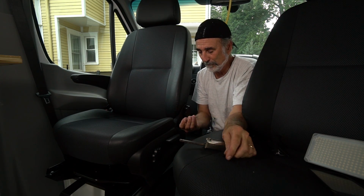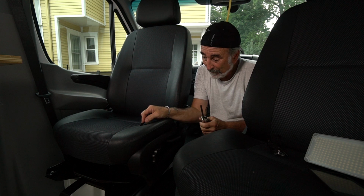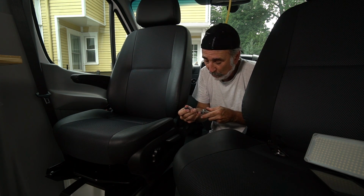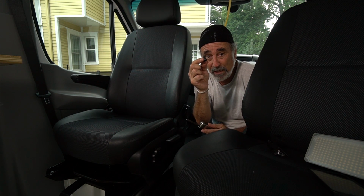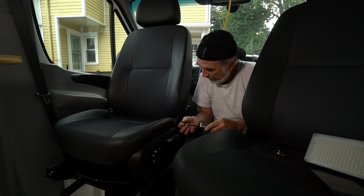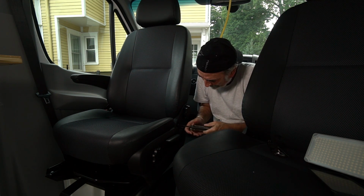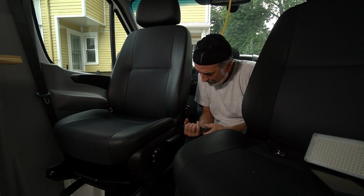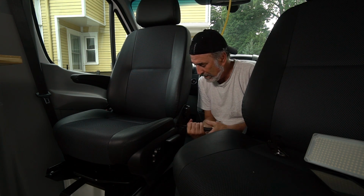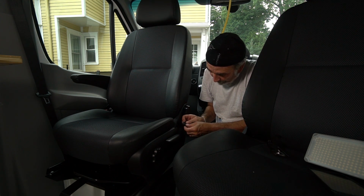I'm over here now. There's one more thing. These little seatbelt screws and those little covers, right? I just wanted to make sure I told you there was no need for the little seatbelt screw anymore because we relocated the anchor point. So what I did is I just put that little screw right back where it belongs, right where it came from the factory. Once it was in, put the cover back on, and everybody's happy.